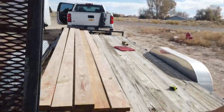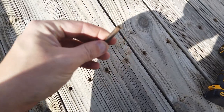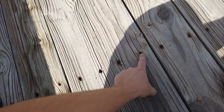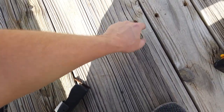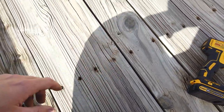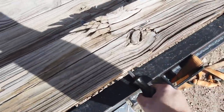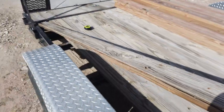I'm going to go ahead and get started pulling all these screws out of the trailer. So far I've pulled a few out and they came out pretty easy. Here are the screws I'm pulling out - they look like they were trying to tap themselves at one time but they really can't drill through. A couple wouldn't come out, so I went tighter and busted them off, then just cut them smooth with the frame underneath. For the most part they're coming out, so I grabbed my old trusty rusty screwdriver, shoved it down beside one, tilted it up, and at least this one will come out.